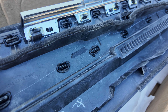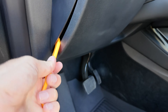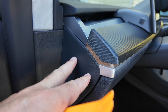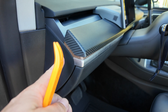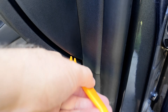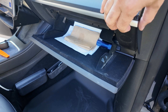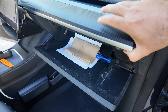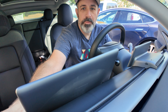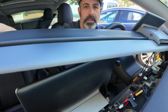I'm going to work on removing the old dashboard and then get this one installed. The first thing to do is put a pry tool right here and just pry out from this bottom point — you can see there is a clasp right there that we just popped out. Now there are two more right here, but let's take the whole dashboard off first. After popping off those lower points, all we need to do is open the glove box, and then with this edge exposed you can just lift up on it and lift the dashboard right out. Pop it up all the way across and then you can lift it out.